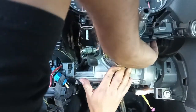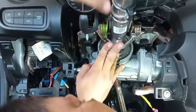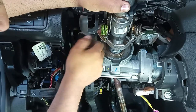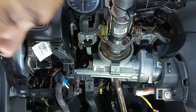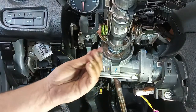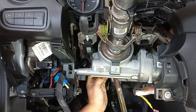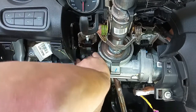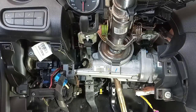This middle section here is telescopic. It assembles from the other section, but there is no issue because it has a master keyway — I keep calling it that; if it's not the right term, let me know in the comments. Now the bolts — just as I showed during disassembly, 13mm heads. You may have to wiggle a bit to get proper alignment. Do not tighten all the way yet — first get the bolts on both sides started.